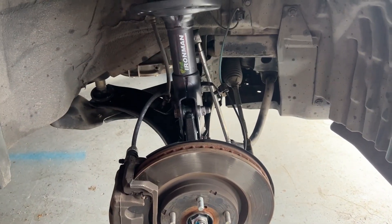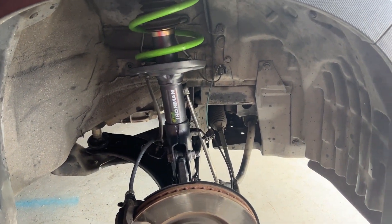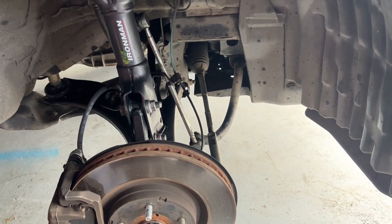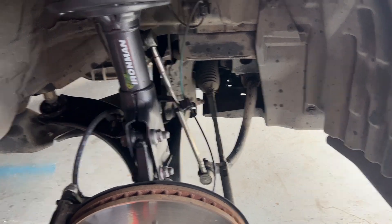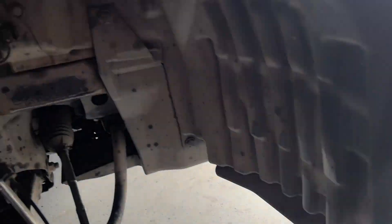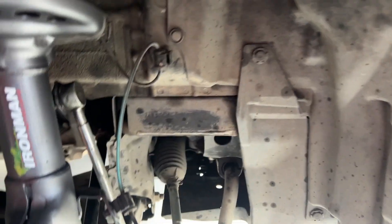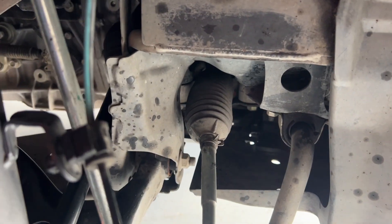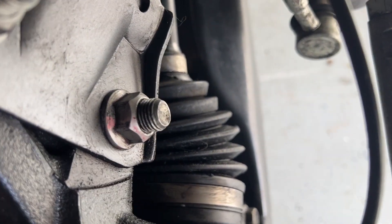As you see, I have my front right tire removed. Reason being, I was noticing a lot of grease buildup on the inside of my rim and little splatter marks all in the suspension wheel well. So what I'm getting at is what you want to do — and this is what I failed to keep an eye on — which is check your CV boots.